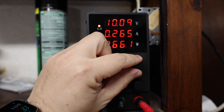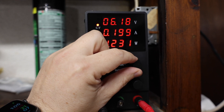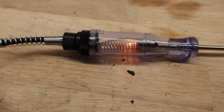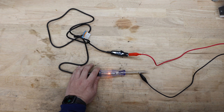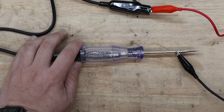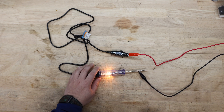Now that I have this on, I'm going to drop it down to 6 volts. And you can see as you go down to 6 volts, you still can see the power — it's still indicating power, just lower because your circuit voltage is less. At 3 volts, you can barely see it. At 1 volt, you can't see it. So you can use this for roughly 3 to 12 volts.